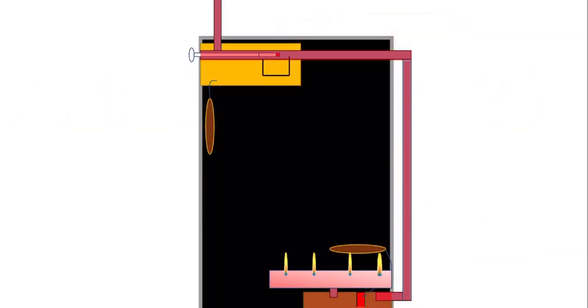So as we can see from here, the gas comes down the mains straight through the thermostat. Has nothing to do with the thermostat bypass at all. It goes straight through the thermostat, down the gas tubes, into the FSD, through the small FSD bypass, and that allows a small amount of gas to enter the burner. When that's lit, that gives us what we call the low rate, and that's the small flame you see when you light an oven.